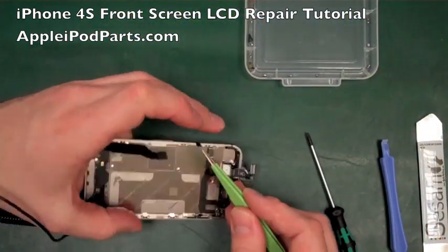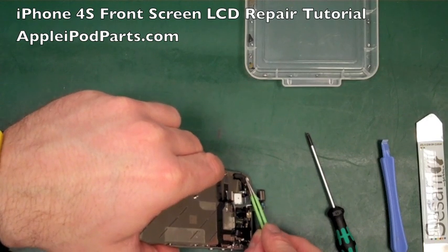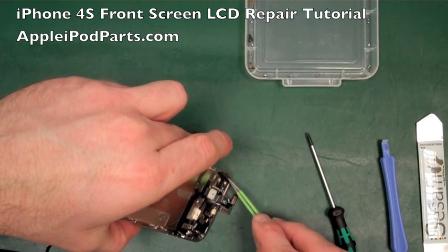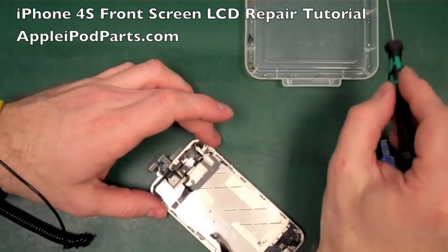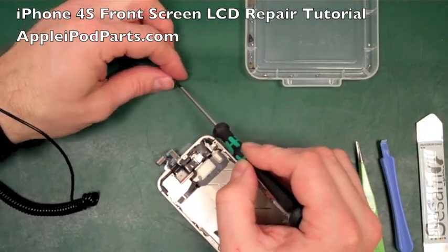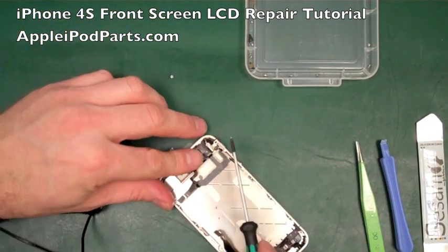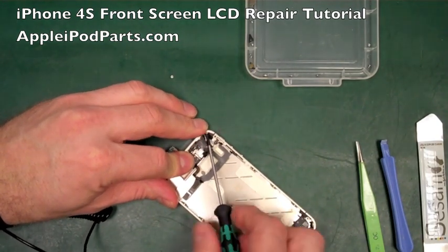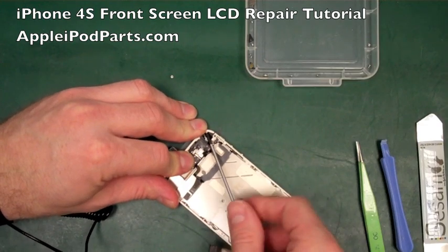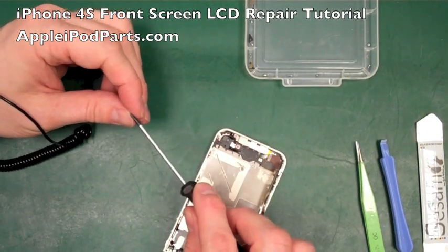And that's again the sort of thing the non-professional repair companies don't bother with. It's there for a reason. It really is. It's not there to be left out. Do you think Apple wastes material and labour time putting something in that really doesn't need to be there? I think not. So it's a case of putting everything back how it should be, and that's what we pride ourselves on. People do it cheaply using crap parts. People do it faster, doing half a job. But that will just bite you in the backside, because you'll find out your Wi-Fi is not working, and you'll go in there and realise that something's shorting against the casing, and it could have been prevented by a tiny bit of tape that somebody thought was unnecessary being put back in.